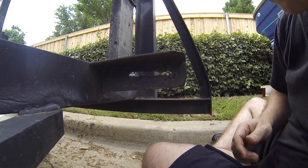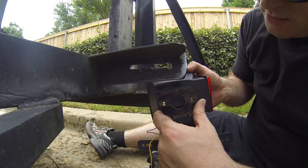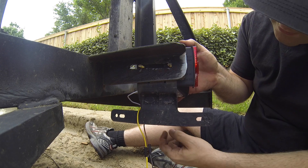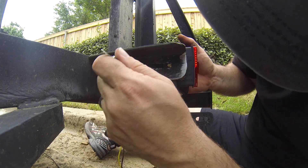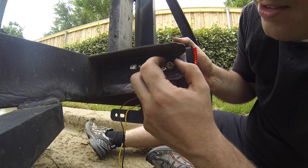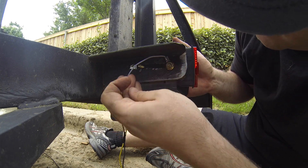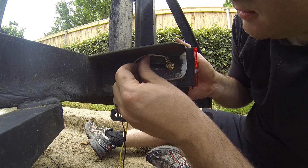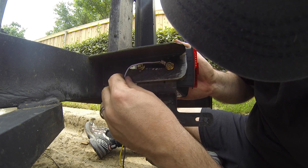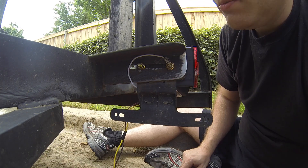Now I'm going to do the same thing to the other side — just file this off. This has a lot more slag than the other one did. This is a license plate holder bracket; that does kind of work. I can feed that through there and attach the wire for ground. The other two leads are already done. Now we're going to take a staple gun and staple up this excess wire to the bottom side of the trailer.